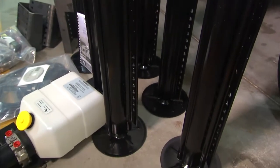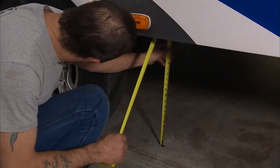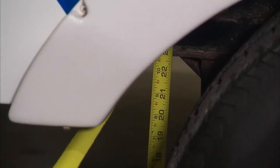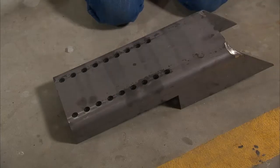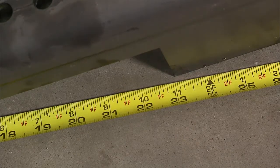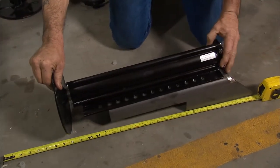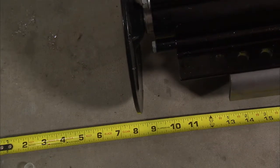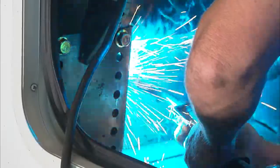After the kit is laid out, they need to make sure that the trailer has a good level stance. They measure in front of the axle to find the current ride height to the bottom I-beam — it's 23 inches. Then they do the same thing to the rear of the axle and also get 23 inches, so the coach is already level. If it wasn't, they could compensate in the brackets because the holes allow for different bolting configurations. That 23 inches has to be at the weld point where the bracket meets the frame. Then they lay the leg on the bracket — the bottom foot pad needs to be between 8 and 9 inches when fully retracted, and that's where you bolt the leg to the new bracket. Once that leg is bolted to the new bracket, it can get welded into place.